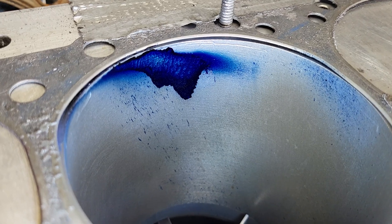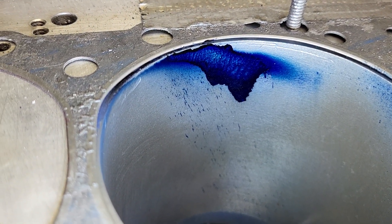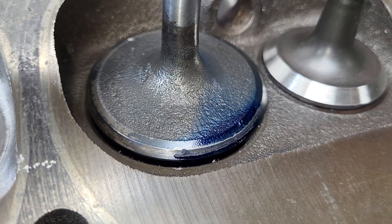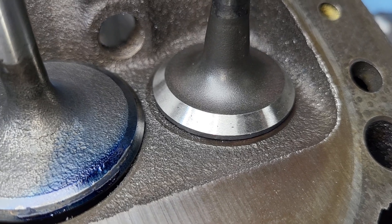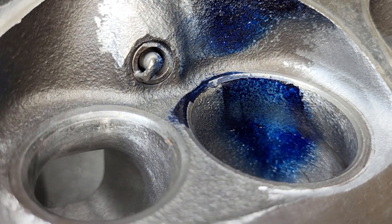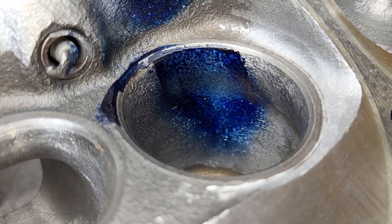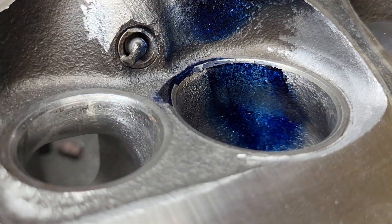You can see the progression in the chamber is a little bit different — the chamber, the bore. The valve looks like it's got less on it than it had on the first cut. I did put an edge on that exhaust valve so we don't have the leakage we had the first time around, so factor that in when you take a look at the flows. The liquid looks pretty good inside the bowl — I'm pretty happy with that.